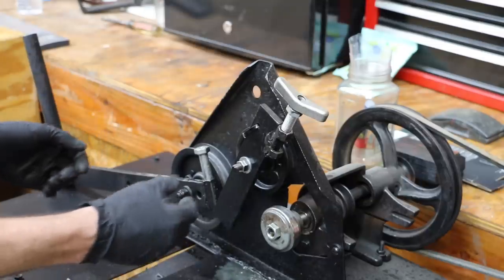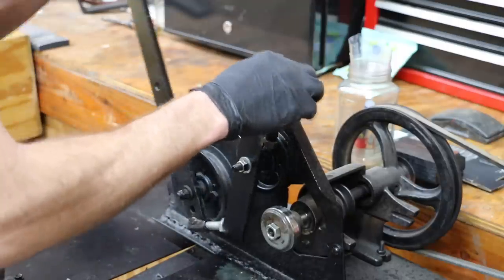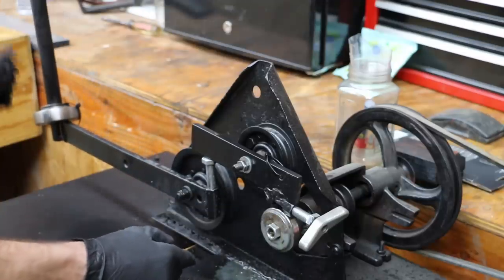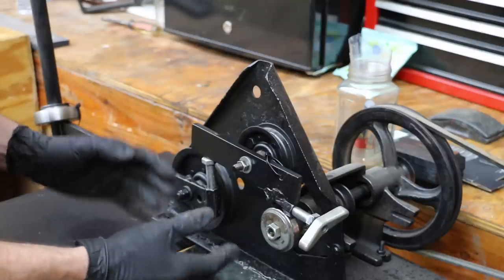So what I'm going to be doing is inserting a new bearing inside the bearing holder, and then I'll be applying the weight to the spinning race. This will spin about 800 RPMs. We'll let this run for 30 seconds, and then we'll look at how much scoring has taken place on that bearing, and that'll be a great indicator.